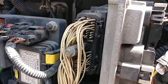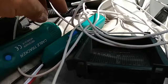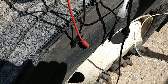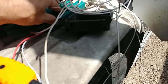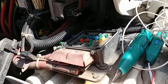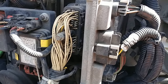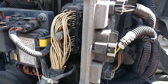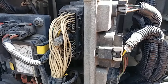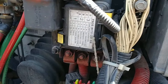So then I take a toner and I want to follow that wire. For those who don't know what a toner is — this is a toner. You connect the leads to it and wherever the wire goes, it gives you a tone. It's not commonly used in automotive but I use it all the time, because as you can see, all the wires are the same color on a big truck. When every wire is yellow or white, it makes it difficult to follow wire runs, and a lot of times you don't get schematics either — so toners come in very handy.